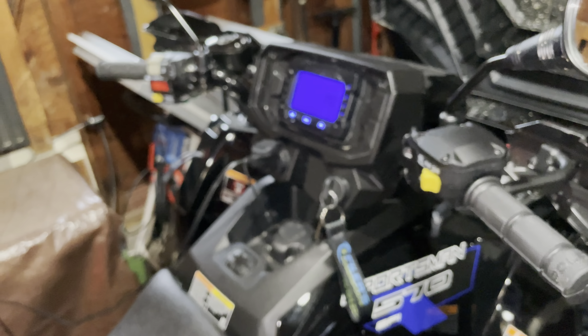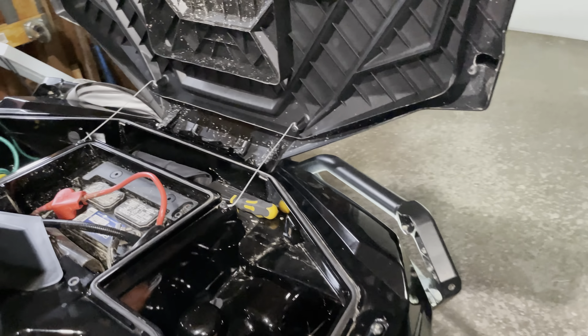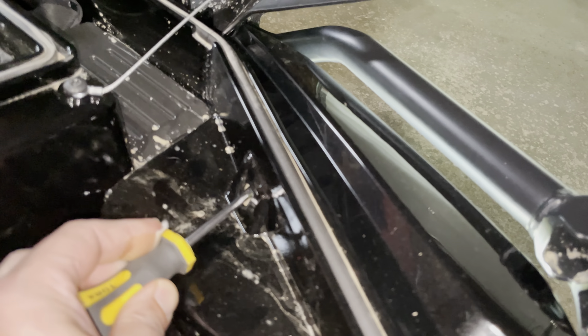Let's go ahead and turn the lights on and try that now. I'm going to need to get this thing out of the way in order to get my Torx 20 in there. Let's turn the machine on. Let's turn the headlights on. There's where the light pattern is right now. So now let's go ahead and slide our Torx 20 in there nice and straight and see if we can find the nut. It's not abundantly easy — let me just look down in here. You can see where it is and I'm trying to line up.